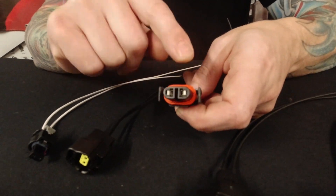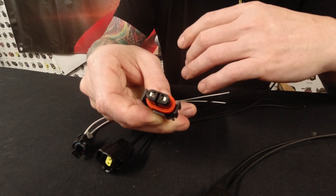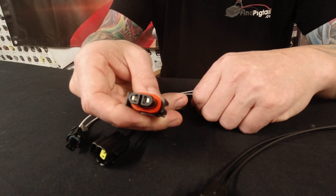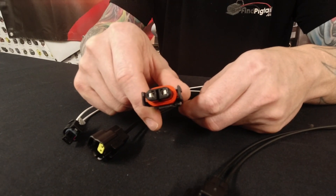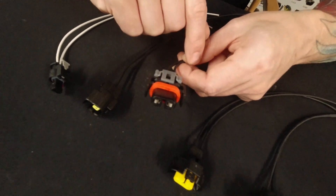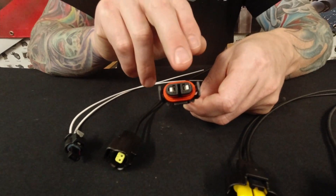The B21B2 is most common for GM stuff and some Mopar low beam and fog lamp. You'll see it inside some headlights where you have a main case that covers it — open it up and you'll see this kind of inside of there. Also externally standard for low beams and fog lamps — very common on a lot of GM stuff. Interestingly, it looks very similar to L43A2, used for fog lamp on Kia and Hyundai, and they are basically interchangeable. Since it's an OE connector, it's going to have all your seals and be watertight.